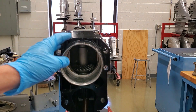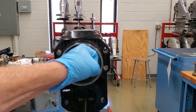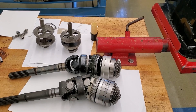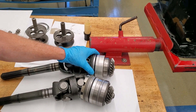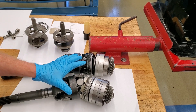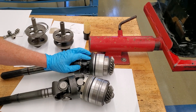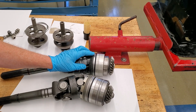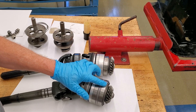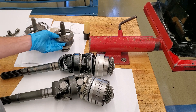The older drives are not as strong as the newer drives, though they are plenty strong enough. The newer drives definitely have a more robust support for that input shaft and input drive gear. Here side by side are the two upper input shafts — you have your yoke shaft and your input yoke — and this is pretty much the same. I haven't measured the carrier threads to confirm, but my assumption is these components are very similar. Then you get into the bearings and the diameter change in the housing — and that's where we need two different tools.